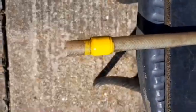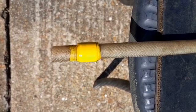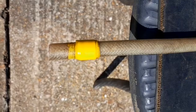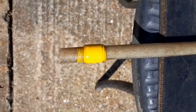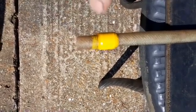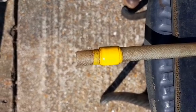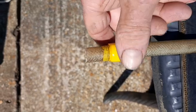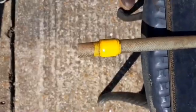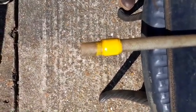That's just a close-up view of the tape around the end of the hose. You just need to wind some tape round it so it's a snug fit in the neck of the radiator hole. Keep it about an inch back so you can just pop that into the radiator and the air can still come up past it. Don't push the hose right in or you won't be able to get the air out.